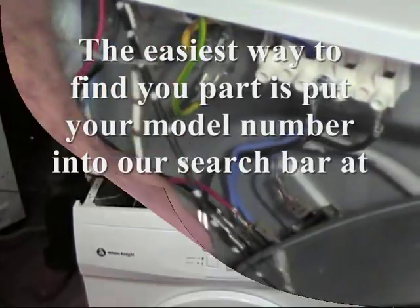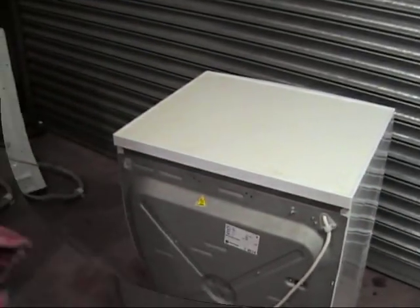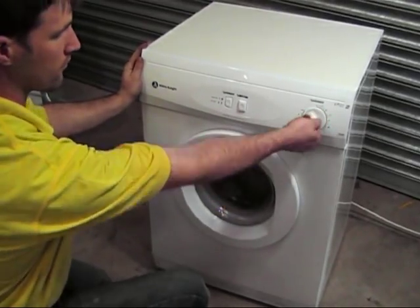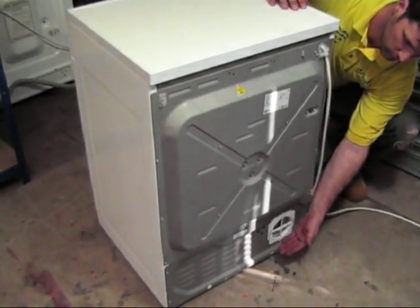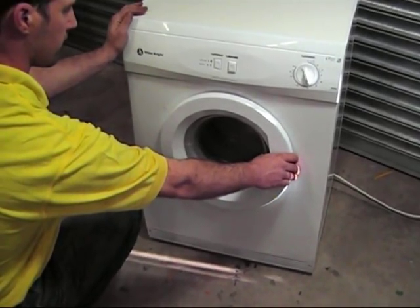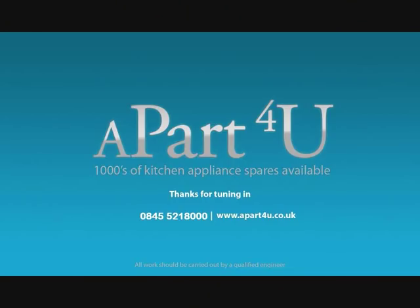Make sure the earth is connected — just connecting the earth there. Make sure you leave all the wiring tidy. Just putting the lid back on and next we'll test the machine. Remember, with tumble dryers it is a very good idea to always let it have its ten minute cooling down period, and always make sure the fluff filter is kept clean as this is what allows the air to flow through the machine, therefore stopping it from overheating. After a few minutes, the machine has reached temperature and now we're getting hot air coming through on the rear vent pipe. You can put your hand into the drum and we've got nice hot air there. We hope you enjoyed this video and remember to shop at A Part For You — thanks for watching.